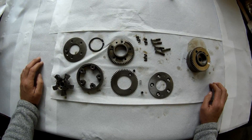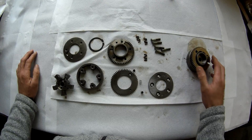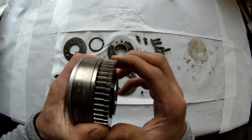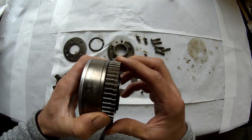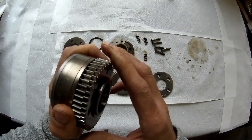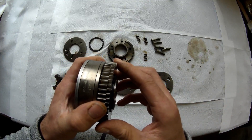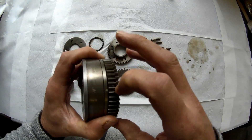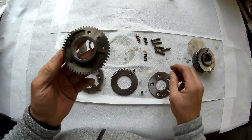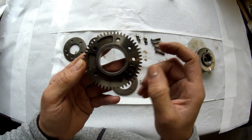To show you how it really looks in there, I dismantled one. The cam gear runs against another gear — that gear holds the timing chain. There is a pretension on these gears to align them, and there is a special tool for it. I think the pretension is to keep a little bit of tension on the gear so there is not going to be any play. Inside, as you can see, there are three springs in there. They are just installed — there is only one way to install them.